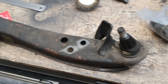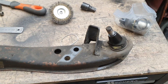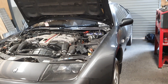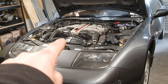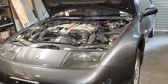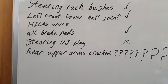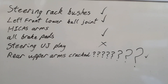These are good because they have an insert that goes into the arm and always sticks on the end of the ball joint and makes life a challenge — but that's all right, we'll get it done. Unfortunately we're not going to get this finished today. We've got all the wheels back on, so that's good. I did get that ball joint in. Steering shaft universal joint has been flagged as loose, but honestly I can't see anything wrong with it at all — I've never replaced one on these cars. Whatever, it was flagged so I had a look; can't see anything wrong. I've written up my list.